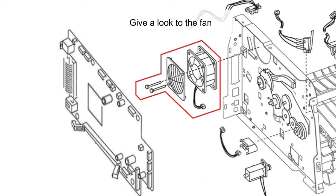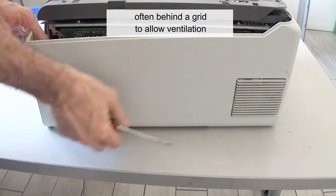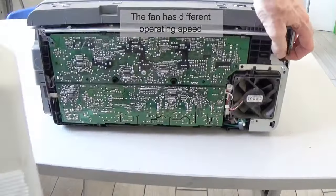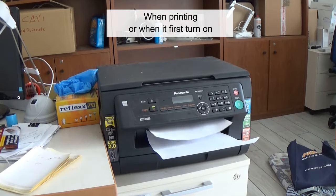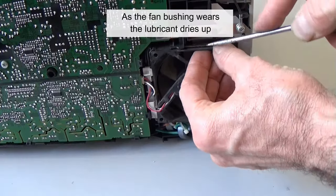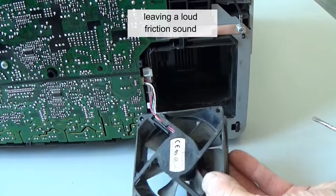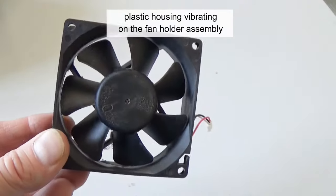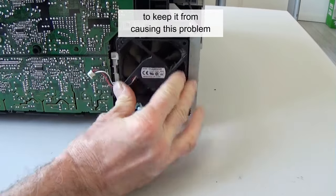Give a look at the fan. Most printers have a cooling fan, often behind a grid to allow ventilation. The fan has different operating speeds — when the machine is idle it runs at low speed, but when printing or first turning on it operates at high speed. As the fan bushings wear and the lubricant dries up, it can leave a loud friction sound. The noise could also be generated by the fan's plastic housing vibrating on the fan holder assembly. You could try putting foam padding around the outside of the fan to prevent this problem.